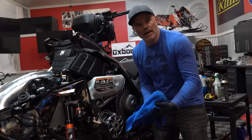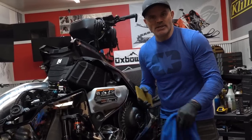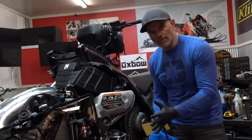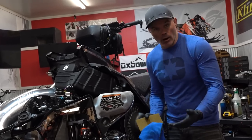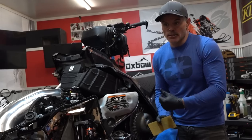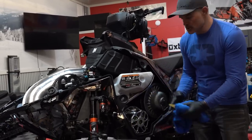I want the best performance out of my clutches, so we've got to keep them clean and dialed. I dig into client snowmobiles all the time — sleds running at a solid 7,700 RPM at elevation, basically riding a 440. You look at the clutches and ask how many miles are on it, and they haven't even really opened up the side panel. But holy smokes, these things look like they've been through a battle — they go through heat cycles, getting cold, snow around them, oil dripping on them. It's a wear item and you need to prepare yourself to take the extra time.